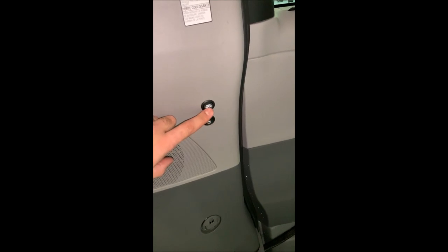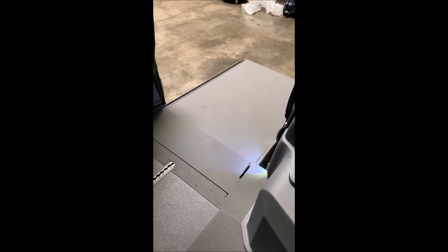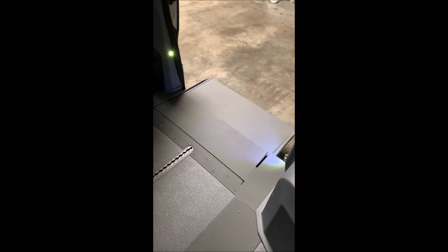An easier way is to go towards the driver's side seat pillar, where you'll find something called the Sure Deploy. To engage it, press and hold the Sure Deploy button. You'll hear a beep, and once the beep stops, you're in Sure Deploy mode. There's a button that says 'in' and a button that says 'out' for the ramp. Pressing the 'in' button brings the ramp in; letting go stops it. Pressing the 'out' button brings the ramp out; letting go stops it. Bring it all the way in, then let go. Once it's fully in, press Sure Deploy again to turn off the mode.